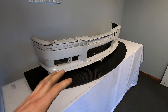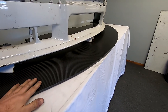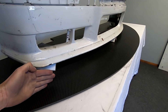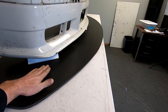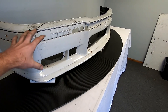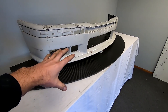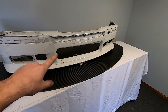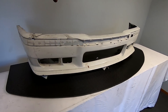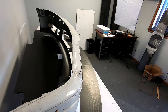Just imagine that this bumper cover was mounted to the car — you're going to have a gap between the bumper cover and the splitter blade, and you're going to need some sort of lip or air dam to fill this gap. You may get lucky and the ride height of your car and where you want to put the splitter just butt right up to each other, but more often than not there's going to be a gap that you need to fill. Mounting this splitter blade is up to you — ride height will be different, you could have brake ducts, a radiator, oil cooler, or power steering cooler back there. You're going to want to run some sort of bracket off the frame rail down to the panel rigidly, but that's up to you for your specific situation.